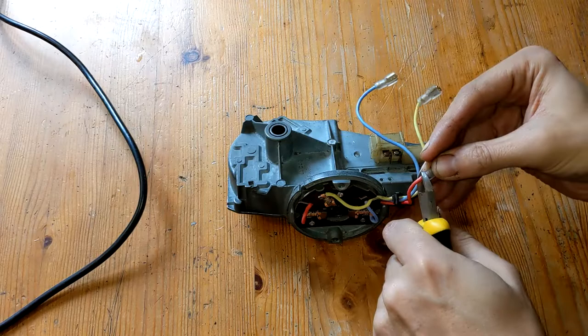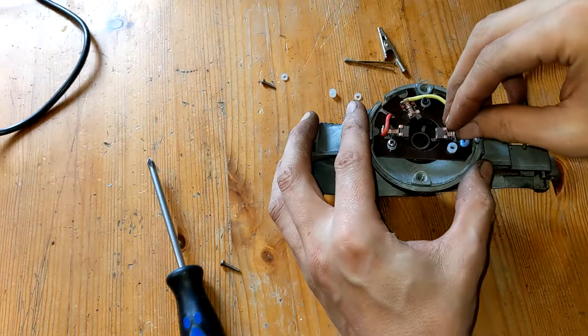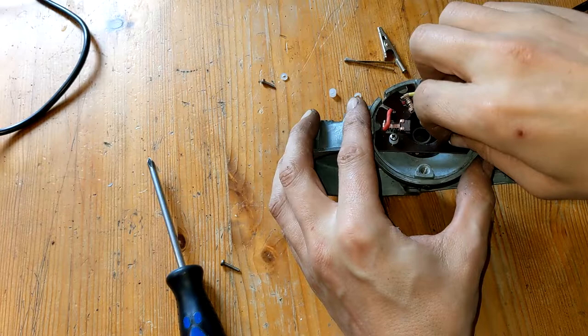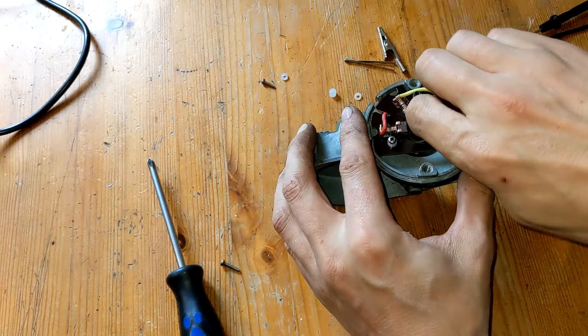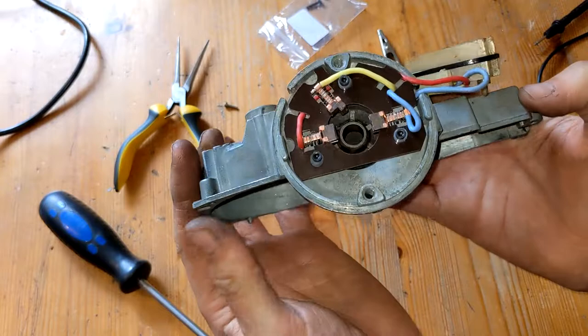The first job was to wire up the new brushes. I was a bit worried about the red wire not being long enough, but it was actually just about fine. Then I soldered the wires to the switch and fitted the brushes properly. The brushes for the 14W sit at a different height to the 16, so I just had to bodge it with spacers. And that's all fitted — with the spacers it all works fine.